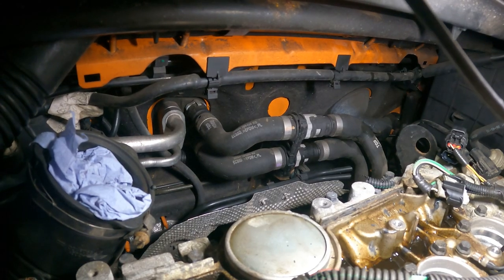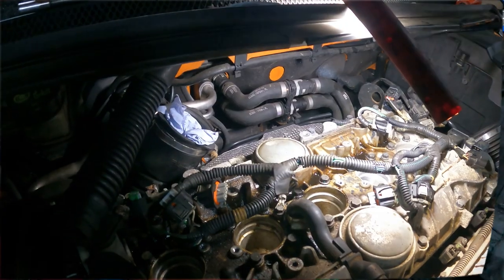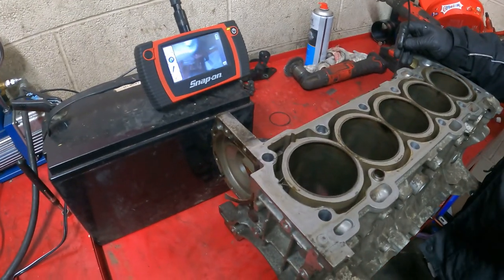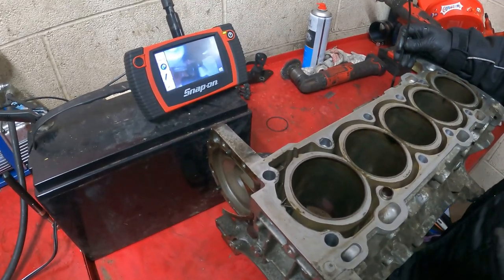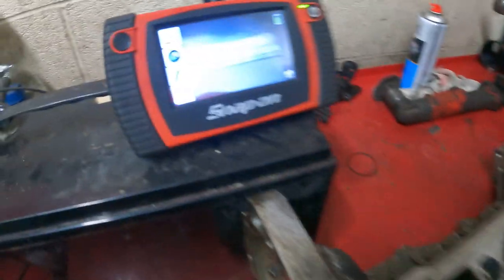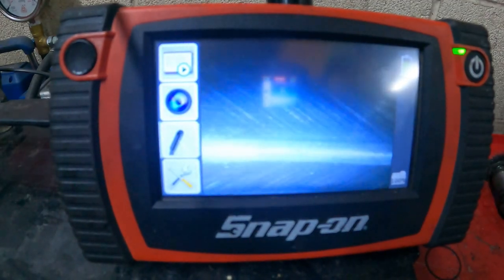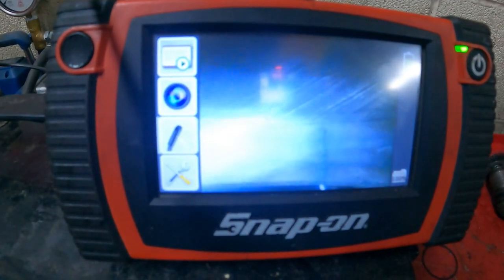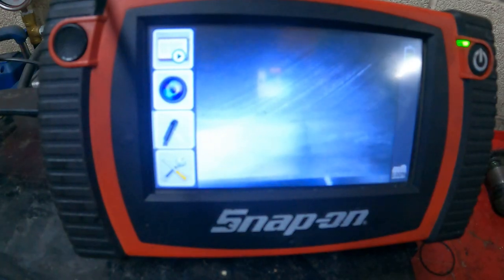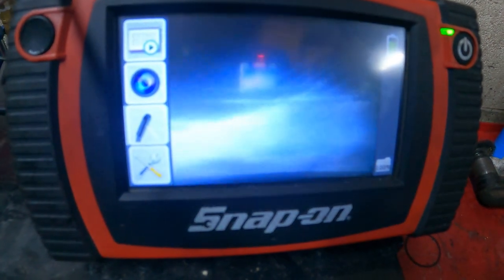Mark's kindly got a block that has a crack in it, just to show you — which we did last week — so you can see what we should have seen on the orange car had it had a cracked liner. So this is us putting the camera in — we would have looked all the way around and then revealed something like that. As you can see, it's pretty evident what the crack looks like — very jagged, very thin. And that's what the crack looks like.